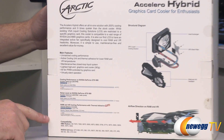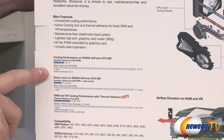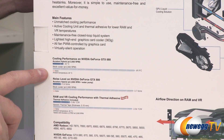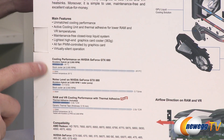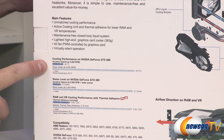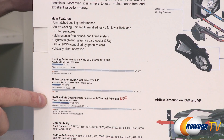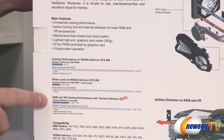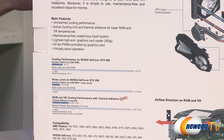On the left side we have some cooling performance data — this is with a GTX 680 versus the stock cooler running at max load. The stock cooler hits 69.9 degrees Celsius; the Accelero Hybrid brings it down to 44 degrees Celsius. It also produces much lower noise output, and you get thermal adhesive for your GDDR5 RAM to lower memory temperatures as well.